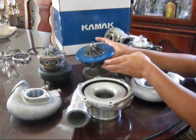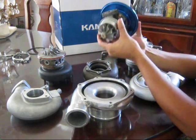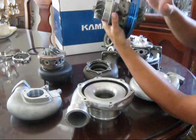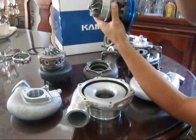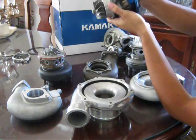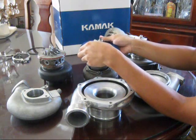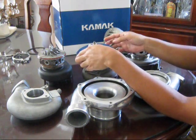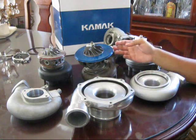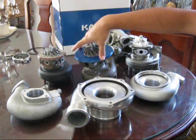There are also two different types of center housings. There's a dry housing, which is oil-cooled only and has no coolant ports. Oil comes in through the top, lubricates and cools everything, then drains out through the bottom. The heat transfers from the oil to the head and block, and gets expelled through the engine coolant.